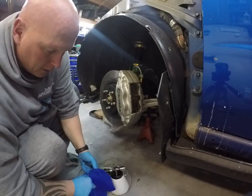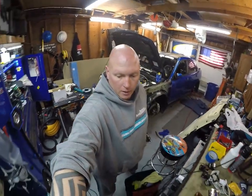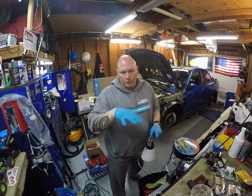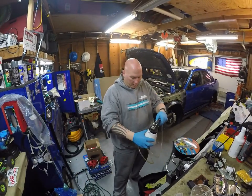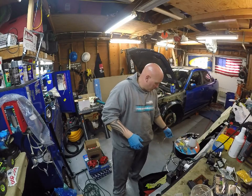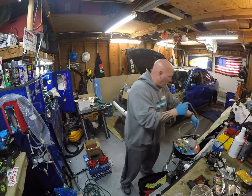So these are all bled. Once this is back on the road, I'll take it for a drive, and then I'll bleed them again. A lot of the times, just driving the car around, shaking it, you get a couple of bubbles in there that'll work their way out, and you'll be all done. So that'll wrap it up for this episode, or vlog, whatever you want to call it.